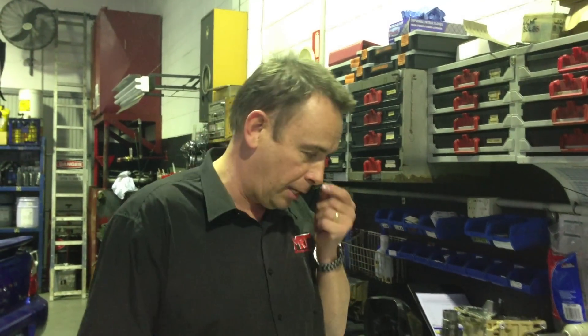What we're looking at today is the Subaru 6-speed transmission in the non-STI performance models. This is the enhanced old 5-speed case, which you can see behind me. Subaru has effectively squeezed an extra gear into this transmission, which is commonly available in the current model Liberty Legacy GT, Forester, Turbo Diesel and those types of models. It's easily recognizable because it has an absolutely shocking shift mechanism via a cable mechanism.